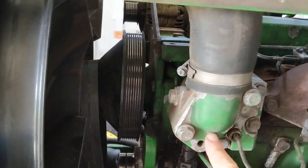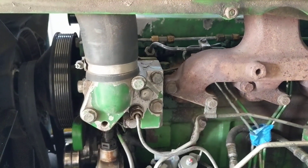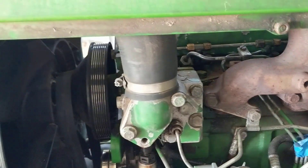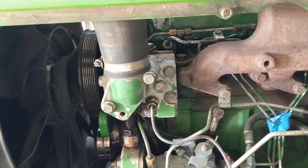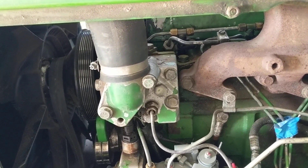You can blow it out from this side too. The second thing: your top radiator hose comes into your thermostat right here — it could be not opening. You can take it out; it costs about 60 dollars to replace, which is a lot, so you may want to just take it off and put it in some hot water.